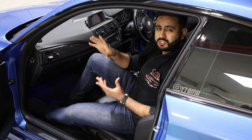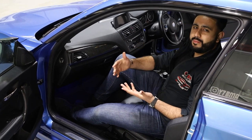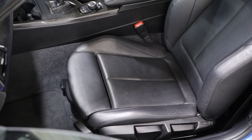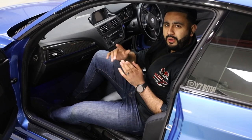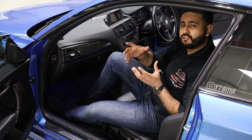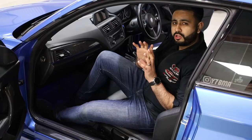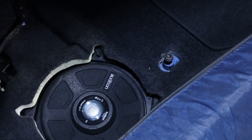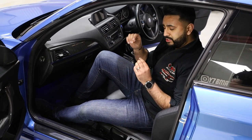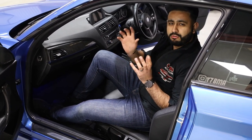Now we've talked about that beautiful soundstage across the vehicle by talking about the tweeters as well as the mid-range performance in the vehicle. Now to add some depth of sound into the system, and that is all carried out again completely hidden out of sight, but also reversible, so we can move the system to the next BMW, we've actually got under seat subs in a stock location. We're using what's called an Audison Prima 4-ohm 8-inch driver, which sits directly underneath the seat I'm sitting on, as well as the driver's seat, giving a really nice soundstage and a lot of depth moving forward into the vehicle. We have actually got a designated sub in the vehicle as well, which is a customer-supplied product, but this component here is designed as a mid bass, as well as adding a lot more depth into the system, and that sound stage now is really nice and full.